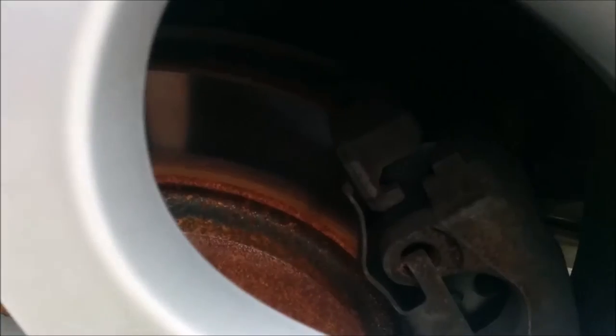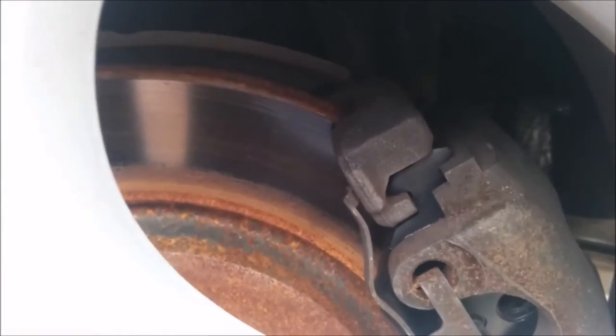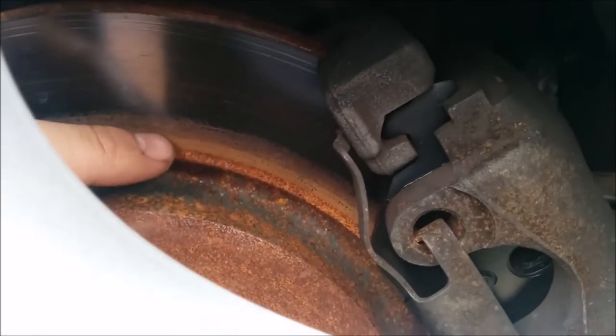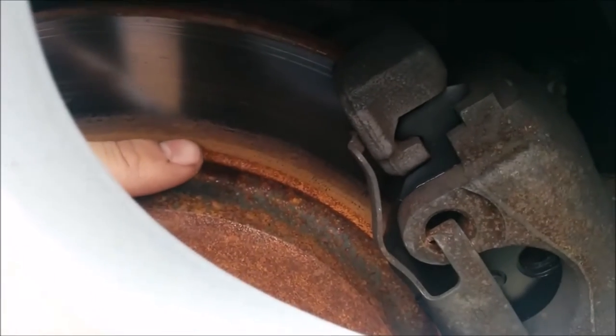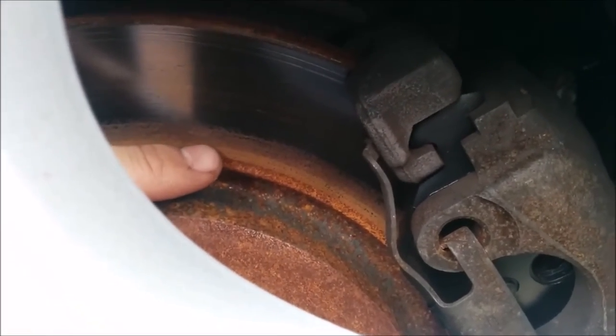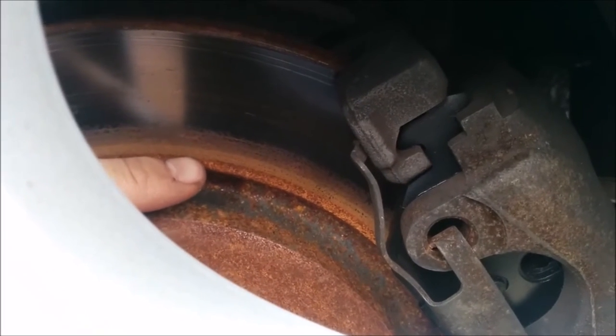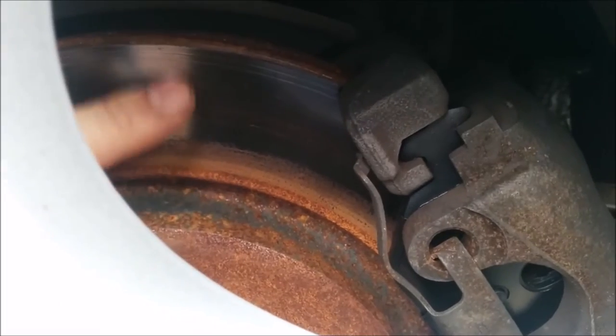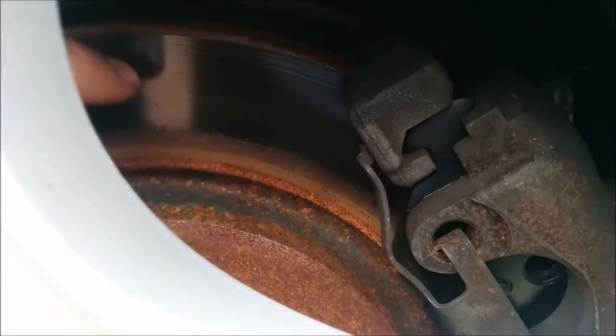Okay, so as you can see, I just took a little bit of a drive and it's starting to wear away here on the outside. After the braking process for seating the pads, it should be down to here — this should all eventually fade back to this color right here, which means there's more contact patch for the brake pads.